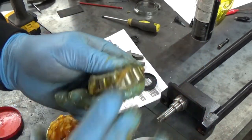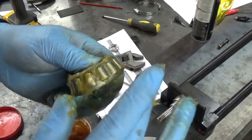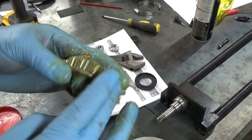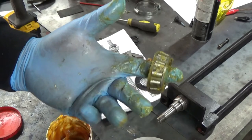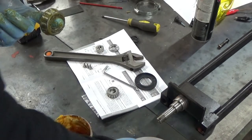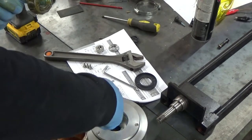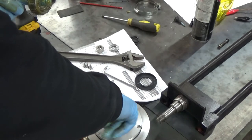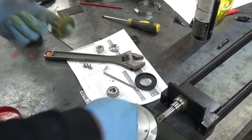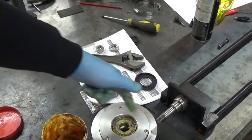I haven't taken grease out of the pot since the last lot because I realized I've got enough on my finger from experience. The amount of waste will go into the rag in a second. You just wipe the last little bit around the outside, wipe a bit around the face, put the bearing in. If you really want to, you can now fill it with grease.